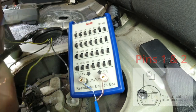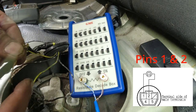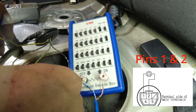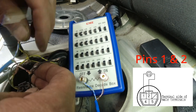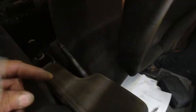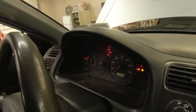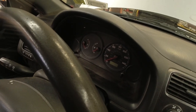We know these are our two wires. We can strip this back a little - there you go, pull that off. What we want to do is check the gauge - that's all this one's going to go to. Grab some bare copper, and watch it - don't short our other leads. Now we turn the key on. If we do this right, we should have a full tank of gas. Alright, that didn't work, it didn't move.